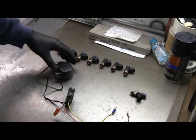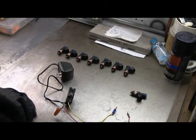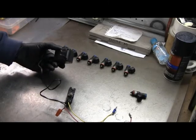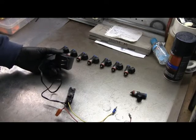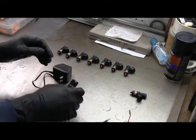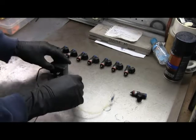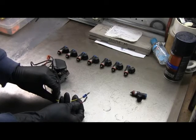To do so, I made up this contraption. I've seen people online just use a nine-volt battery — that would work too — but I didn't have anything that would easily attach the wires to a nine-volt battery, so I did this. I had one of these as an extra AC converter for a cell phone or something. It puts out a little over nine volts, so it's pretty good right in the middle of where these things are supposed to be energized. This is just a scrap push switch that I had, and then I put some connectors on the end so that I could attach it to each injector.